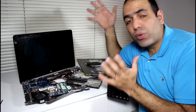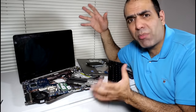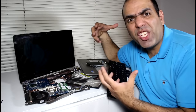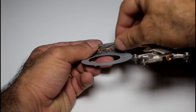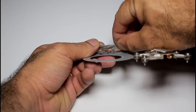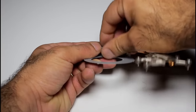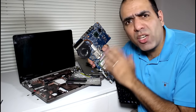Here, I'm jumping forward to an important point and I'll jump back later. I have opened my laptop and the problem was something I totally ignored, although the signs were obvious. My laptop has been overheating and shutting down for a while now and I blamed it on summer and global warming. In fact, the air channel was totally blocked with dust and lint and sh**. Eventually, the fan heated up so much, it died. The cooling fan constantly sucks dust in, and over years, the air channel will block.